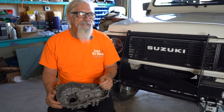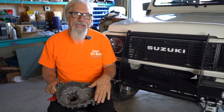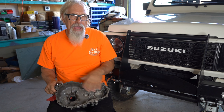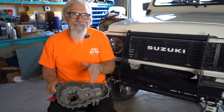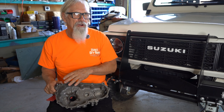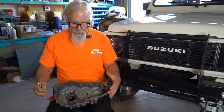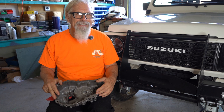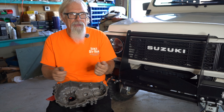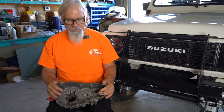One of the things I also wanted to talk about is that the gasket is a shim between the case halves. When you're putting this together you want to put it together dry first when you're doing your bearings and gears. That's when you're going to find out if you need a shim, because if you only use silicone here you're not spacing it correctly and you can cause a lot of damage in your T-case. Remember, the paper gasket is a shim and it has to go in. That's when you're going to be pushing your input and your main gear back and forth and finding out if you need to get any shims to cut down that extra space.